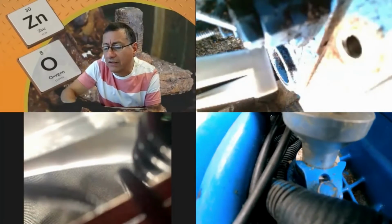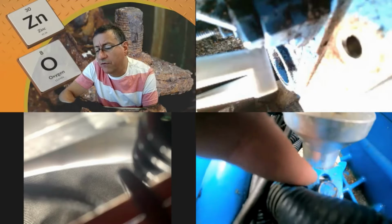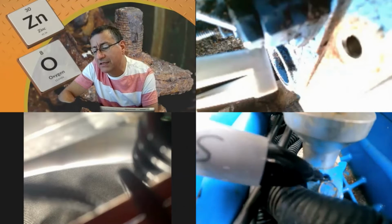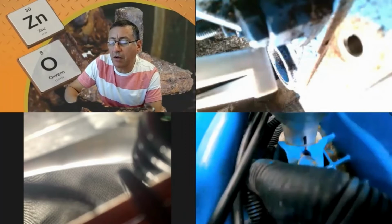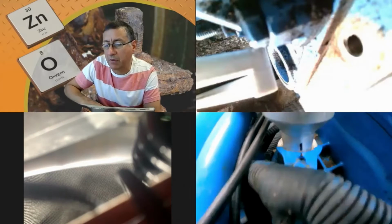Pay attention. You know what is the clip? The clip in the bottom? The blue? Exactly. In front of the ball, we are going to pass one line from the ball through the body of the distributor. Exactly. One line over there. Now, go on top, and we are going to remove the plastic cover of the distributor, the cap.